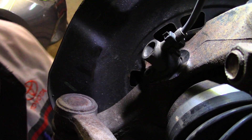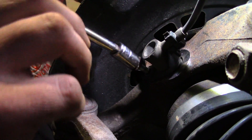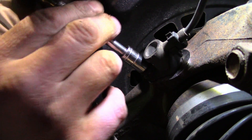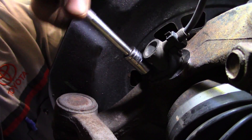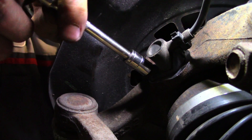All right, it's all cleaned up. I took the paper out that was protecting the tone ring, made sure the sensor is all clean, and we'll see if it's fixed. I was able to clean out inside the hole — I just used a little file — and put the sensor back in, throw the wheel back on, and see if the amplitude gets any better.